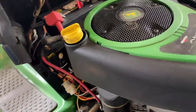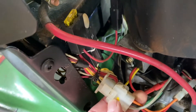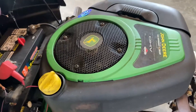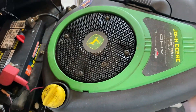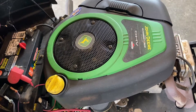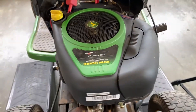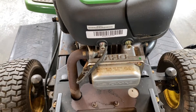On the right-hand side, I'm going to unhook the starter and unhook the wiring harness for the engine right here. Once you do that, I'm going to take the cover off so I can get to the crankshaft bolt underneath so I can stop it from turning. We'll go ahead and take the engine cover off just to make everything more visible. Also, the exhaust — the muffler just pulls right out. You don't have to unplug or unbolt it, though we may just for access and to make it easier to see on the video.